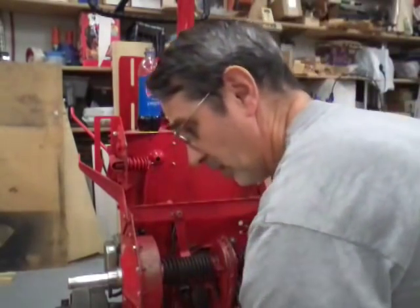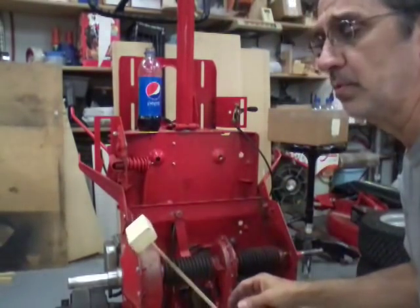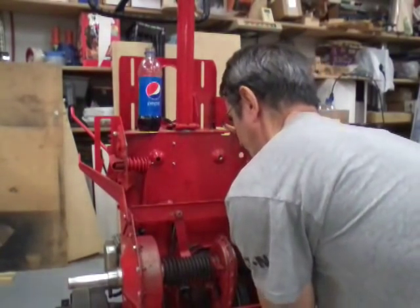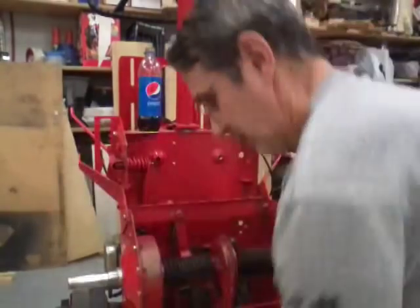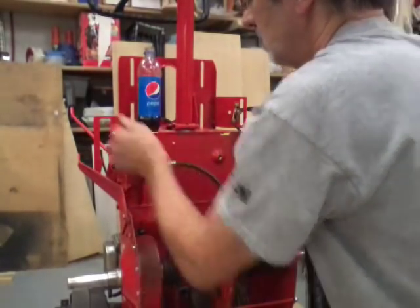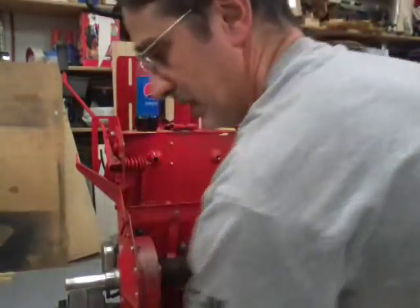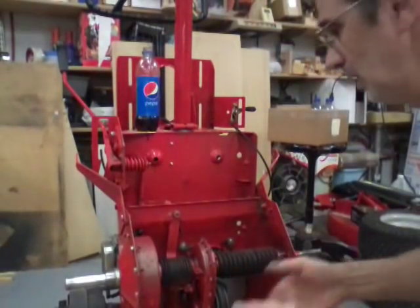To get that to move you have to depress the clutch somehow — I use my little piece of pipe which is about three inches long. I'll lift up the yoke and put that under there; that'll allow me to shift this without any problems. We want to fill that full of grease. You can shift it in different positions as you're doing it — that will help spread the grease around.